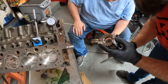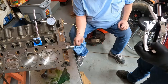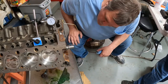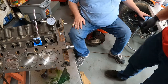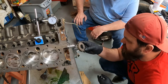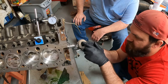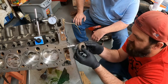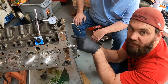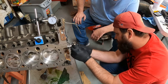Not too bad to pull that — we had to use a piece of flat strap because this thing's got a sharp point and we didn't have a nice round thing, but it's just a four-inch puller from O'Reilly's. So we've got a marred-up key we're gonna clean up real quick. Like I said, we've already degreed this and decided it was four degrees retarded, so we need to advance it four degrees. We've got the timeable timing chain — all we gotta do is go to the A keyway instead of the regular one. Instead of lining up the timing chain dot like normal, we line it up with the A on the smaller gear, and the dot will still be up on the bigger gear — and it should line up and be beautimous.